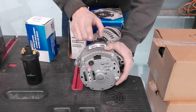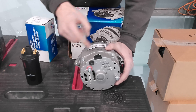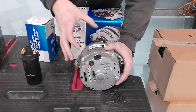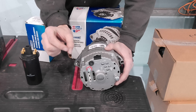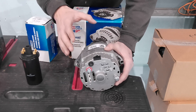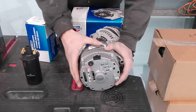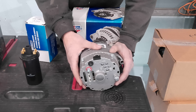If you don't put in that indicator light and you just jumper it down, it'll back-feed the system. Even if you shut the key off to your points, the alternator is still sending power out to the points so it will still run. I've only done one tractor with a three-wire alternator and I wasn't a fan, so I'm sticking with the one-wire alternator.